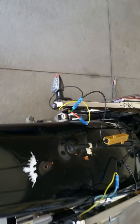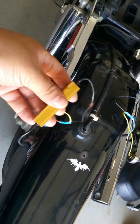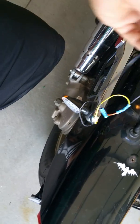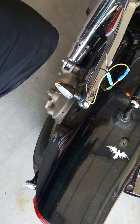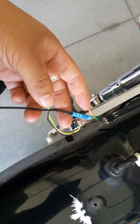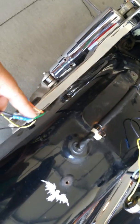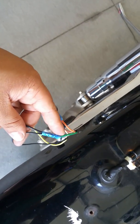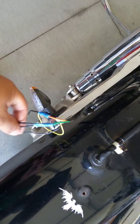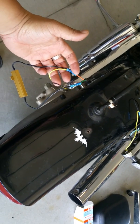That's all it took. I finally got them wired in really simply. I don't think there's a plus or minus side — they're kind of universal. Coming right off the turn signal, they're called load resistors or load equalizers. On one side connect to the turn signal, and then the power coming off the factory wiring. That's how I wired it up — real simple, easy peasy.